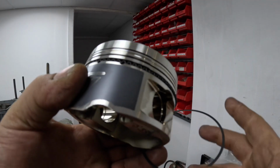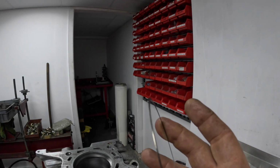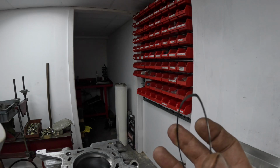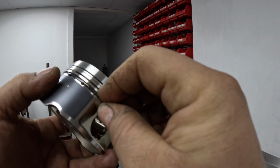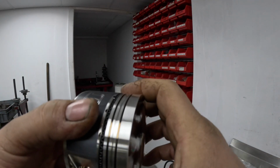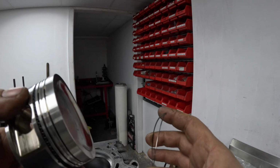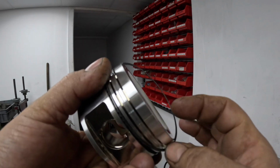And then with the oil rails, I just very carefully flick them in like that, and whichever way the ring rail points, I have that pointing towards the oil control ring, so that it would be at the bottom, pointing to the control ring there. Then I just put that in there and carefully roll it around, making sure I don't scratch the piston when I drag it in, and then sit that on the thrust face, or opposite the thrust face. Okay, so the second ring, I want that way so it pushes down, and then I'm going 180 degrees opposite where I fitted the first ring.